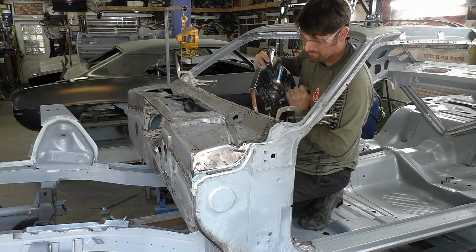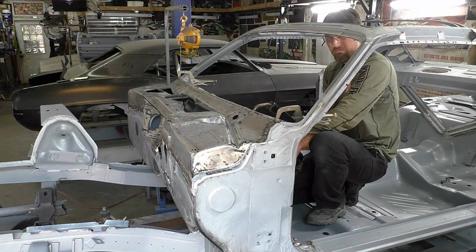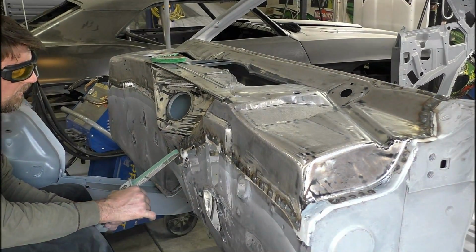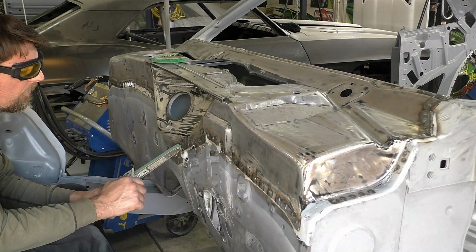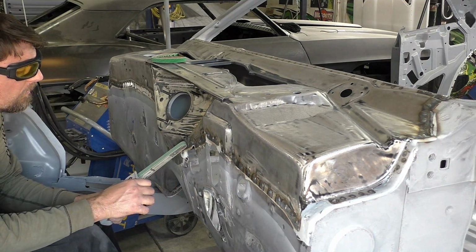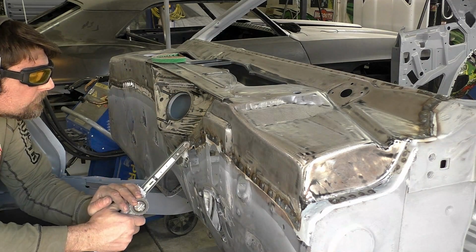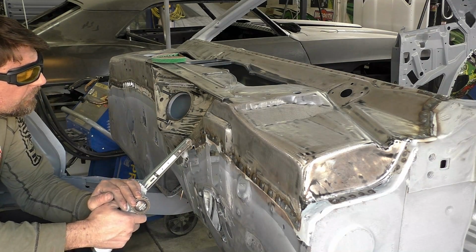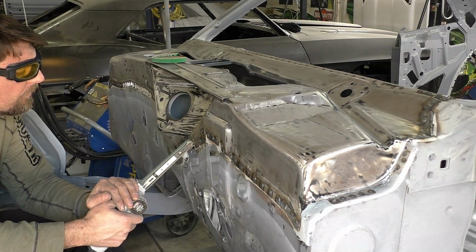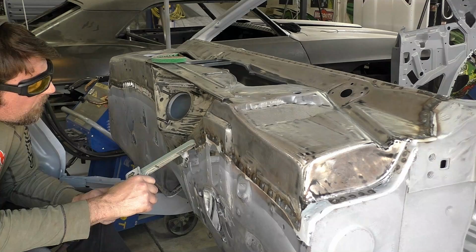You can see I'm working my way down. I got my clamps on the edge. I did work with the MIG holes all the way up already, so that area should be good to go. We're going to go back through now that we verified everything's welded, and we'll go through with the belt sander. This is 80 grit on a belt sander. I'm just easily touching it up and smoothing everything out for the most part, just to make everything look smooth.